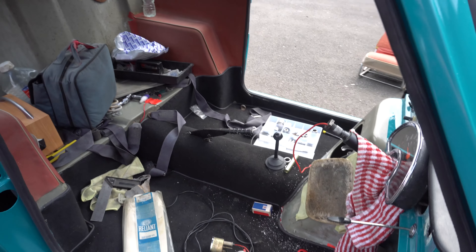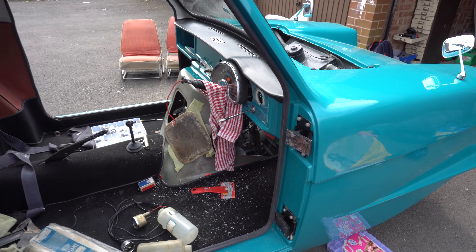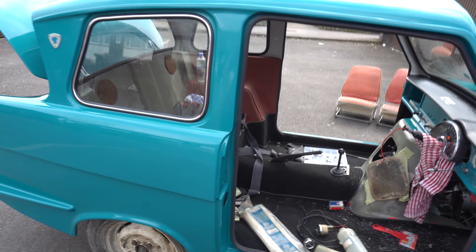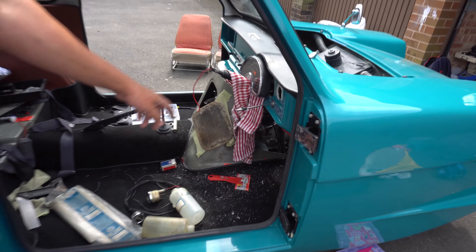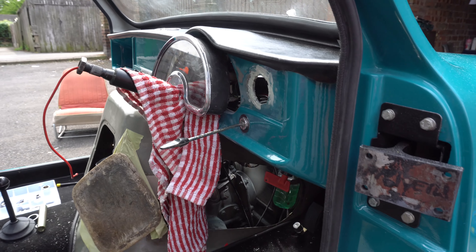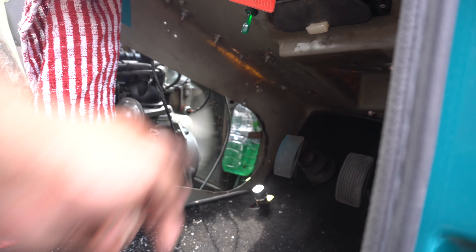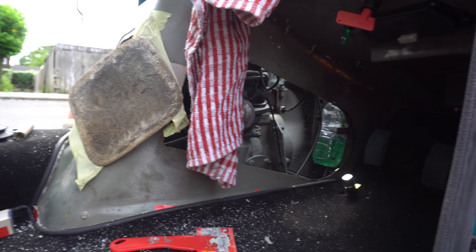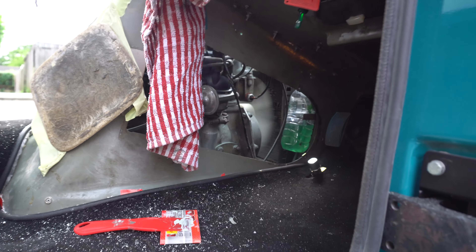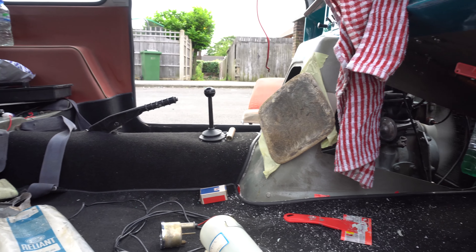It's a little bit of fettle here and there — it's really quite sweet. So this is Part 3. I'm finishing off putting in the interior. As per the 21E, the dashboard is painted — you can see where it's painted down to. Under here there is a battery kill switch, and there's a switch for the fuel pump which I didn't have on the original. Electric fuel pump — it just makes the car start easier when it's switched on. I found the mechanical fuel pump before I started all this was just taking forever to get it to start.